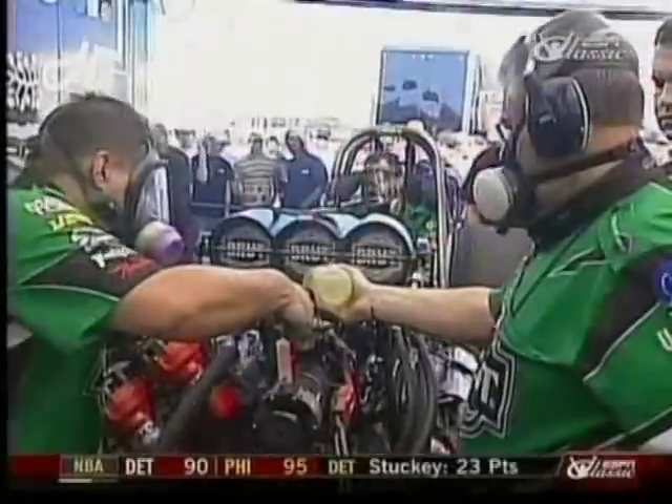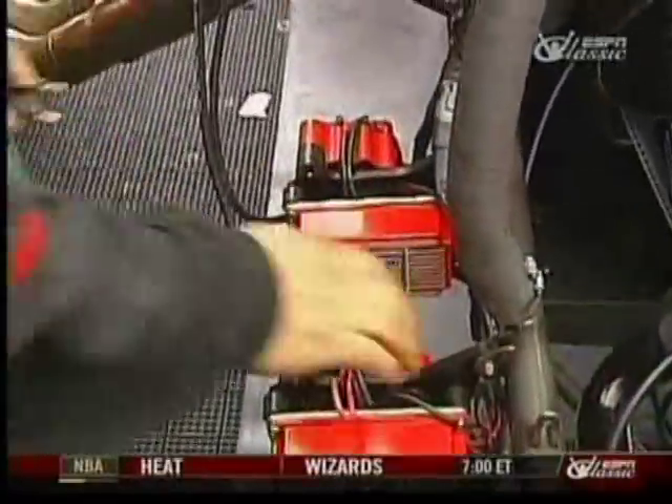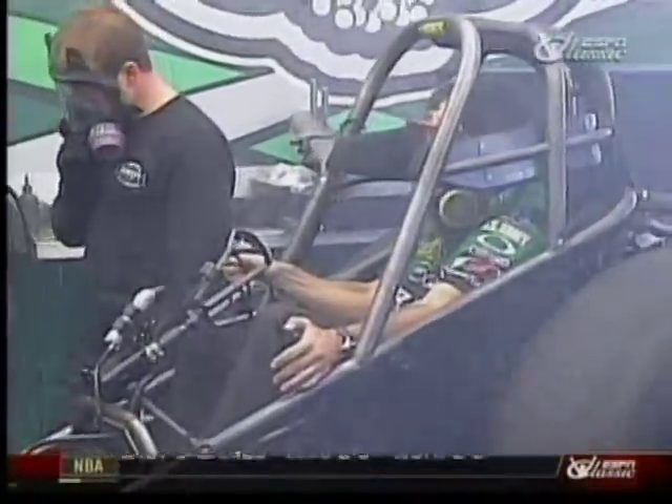That's what happens when you see an explosion when they start it. At that point I'll turn the ignition switch on. The starter is going to be spun over by a crew member and he pulls a mag wire — that's going to light the car. Once it starts, I pull the fuel pump on real quick. That puts the fuel into the motor.